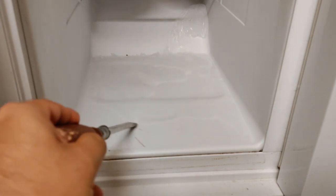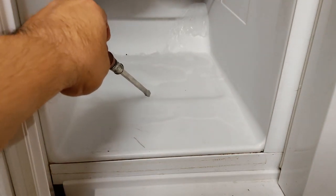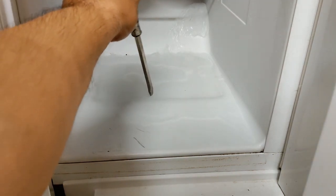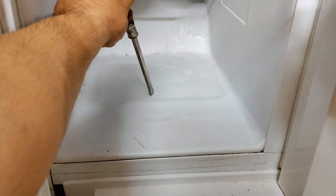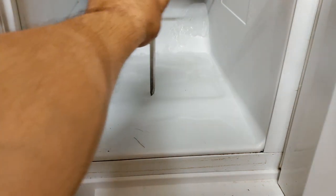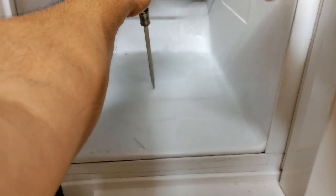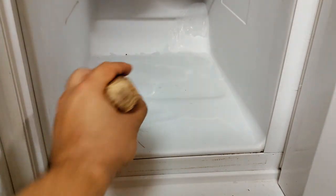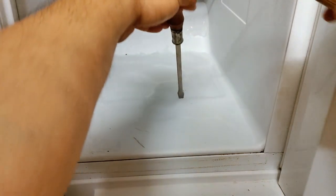What we're going to do is probe around using some rotational motion and some torque to try and find any weak points. I found a little groove here where there are some extra ice pieces. So you get a nice little handle like this and give it a little tap. I'm starting to go in a little bit. All I'm doing is probing right now, going along the fault lines. The reason why is because I want really big pieces — I could shatter all of this, but big pieces are easier to grab and throw into the sink.